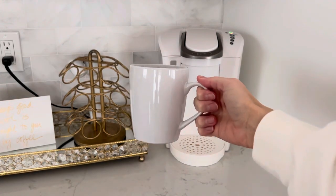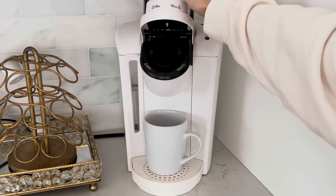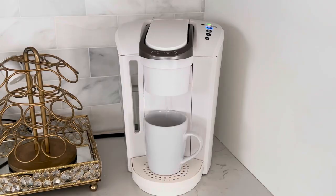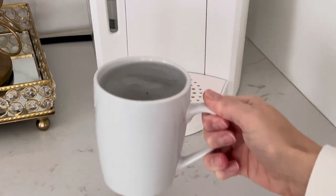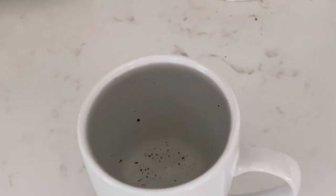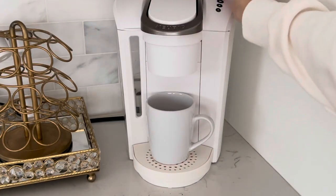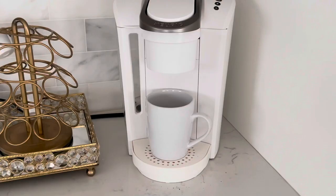Go ahead and turn it on, grab a larger kitchen mug, and run it just like you would when using a K-cup. The vinegar is going to go through the system, clean everything out, help descale and deep clean it. It's going to be very hot and steamy and you can see all the debris and particles that have been left over. We're going to do this a couple more times until the vinegar gets down to the bottom of the reservoir.